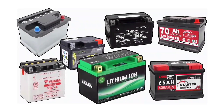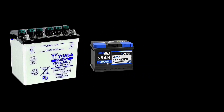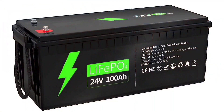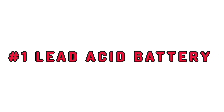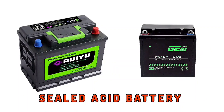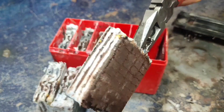What are the common types of vehicle batteries? Batteries come in various types, sizes, and capacities. Most cars and motorcycles use 12-volt batteries; older engines sometimes feature 6-volt batteries, while some heavy vehicles utilize 24-volt batteries. The most common types include lead-acid batteries, which are the most common and are categorized into two main types: sealed dry batteries and wet flooded batteries. All 12-volt lead-acid batteries are composed of 6 cells, each containing positive and negative lead plates immersed in an electrolyte.